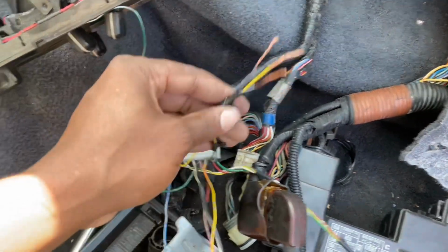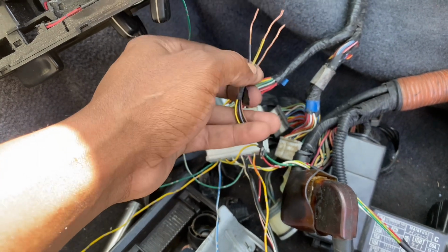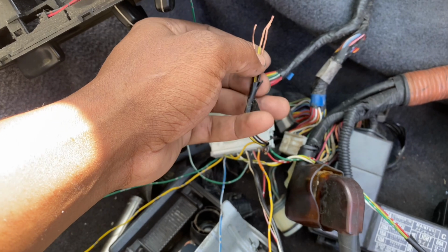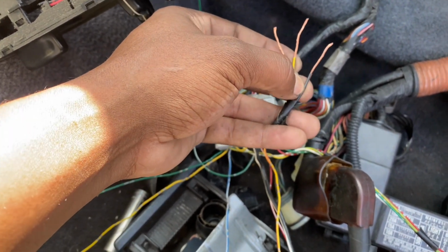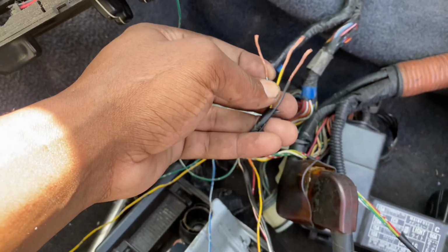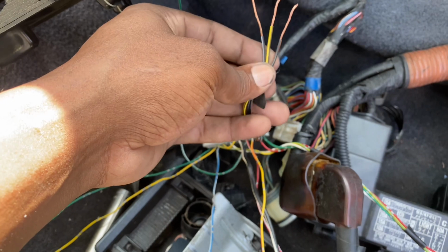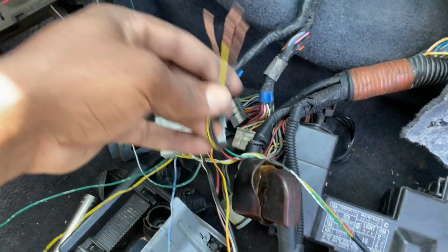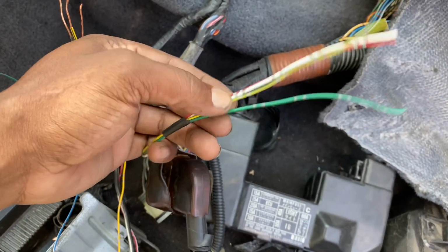And then you got these three wires, which are 9, 14, and number 20. These are ECU powered. You need these on a switched power. So switched power means the ignition, when it turns on, sends power through a relay. So never power these with 12-volt power directly. And then you got these four right here. These are for your O2 sensor.